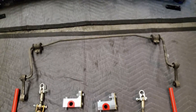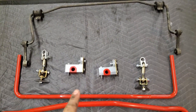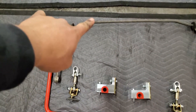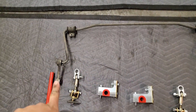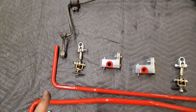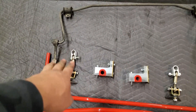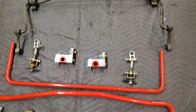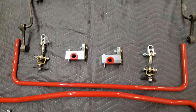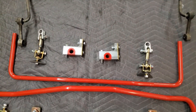You're going to want to either disconnect the hose for the gas tank or just undo it and slide it out. You can definitely see the thickness difference between the two bars — this one curves down and then curves back in so that your point lines up with your trailing arm, whereas this one just comes out straight and goes straight to your trailing arm instead of curving back in. I'm going to line these up and then we'll mark our holes to drill.